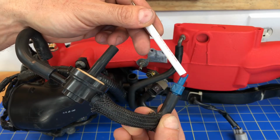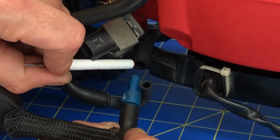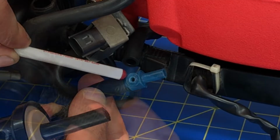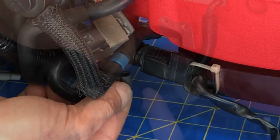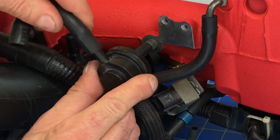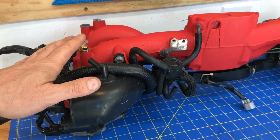And then this side, this little blue fitting, should be a 3-way fitting, but it has a little nipple broken off. This little 3-way fitting goes down here on the bottom, so connect that blue T-fitting into that fuel vapor recovery hose, and then connect this smaller 1/4-inch hose to that smaller port on this T-fitting, just like this. That smaller port should rotate down so that this hose can connect right into that smaller port on the bottom. And then you can go ahead and connect this little small 1/4-inch port right here. And this port connects right here to your air intake, like that. Okay, and that evap system is completely installed, and this intake manifold is ready to be installed back on this EJ205 engine.